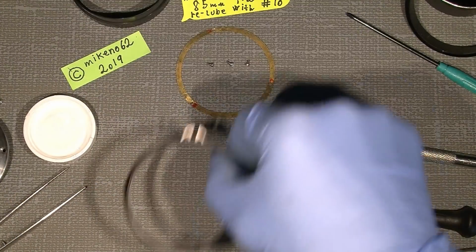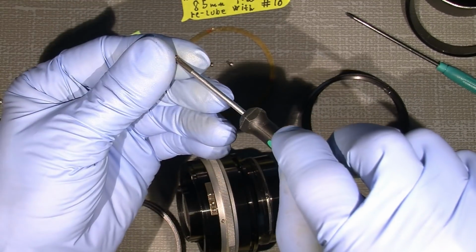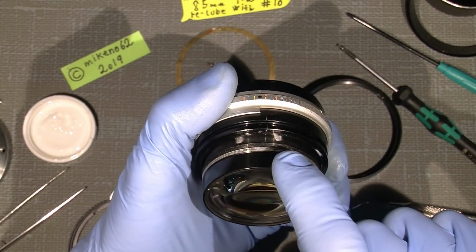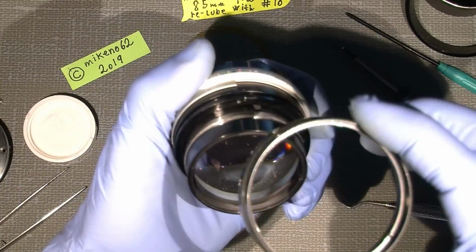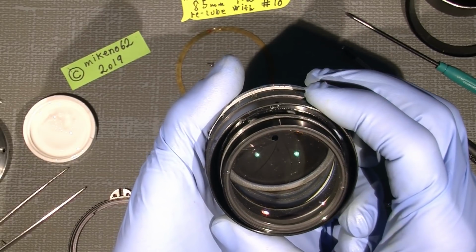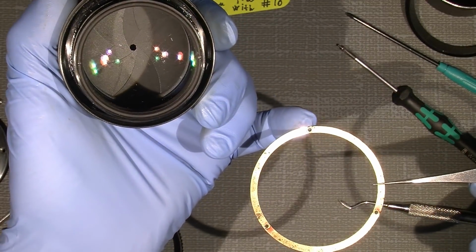So now I can add my focusing ring itself, and also add a screw there. Now set the focusing in line with the 3 marks you set, and I also set a mark here, which you possibly remember. So I can just set it here, hold it, and then add the thin brass ring, which also has a mark here,